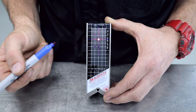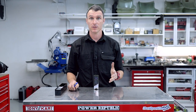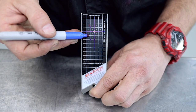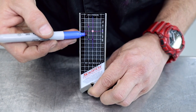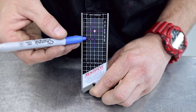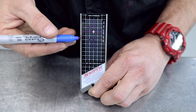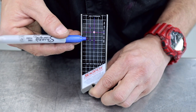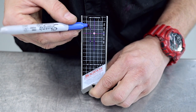Run between toe out and neutral. Another question we had is in regards to positive and negative camber and when we're going to be using it. At our local track we would run negative camber if the cart is too direct on the way into a corner — from the end of the brake zone to the apex, in the first half of the corner. If we had problems where it was turning too sharply, we'd have a tendency to run a little bit of negative camber, and that's traditionally with brand new tires. As the weekend progresses and the tires start to wear, you'll notice the inside edge is starting to overheat and degrade ever so slightly, and we start to move back into the positive camber.